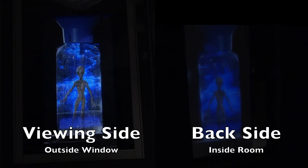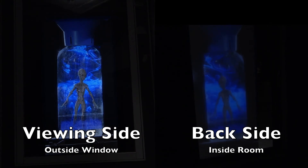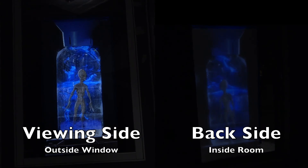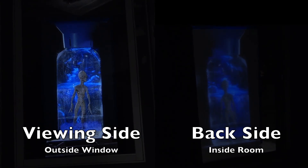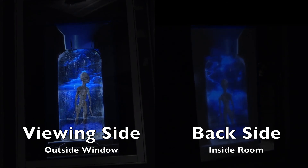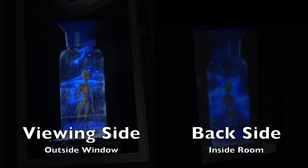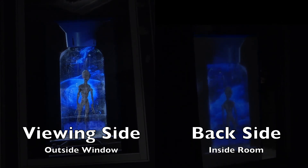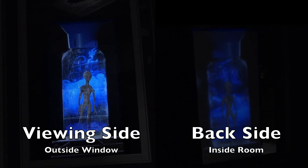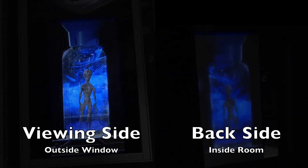This rear screen is nearly 90% transmission on the viewing side. Here it is on the inside standing next to the projector, and you can see it's quite a lot more faded and faint than when standing outside looking at it on the correct viewing side for rear screen. This is quite good material — it does a very good job. It's supposed to be far brighter on the rear side than the front side. If you're going to use front projection screen, use a white painted wall.